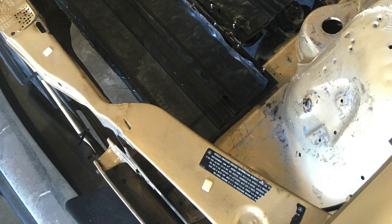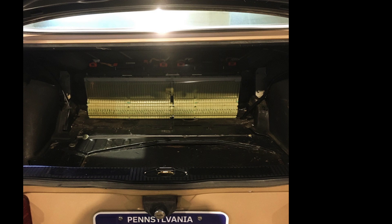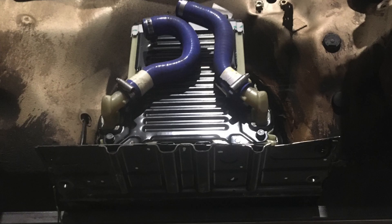That left me with three more batteries to mount somewhere. The obvious position was inside the trunk. In the 300D, the original fuel tank sits behind the back seat and before the trunk, with a separation panel between them. After removing the fuel tank, about one and three-quarters widths of these batteries could fit where the tank was. I originally thought I'd put all three batteries there, but I was actually able to fit one battery in the transmission tunnel, which freed up room for a regular-sized trunk.